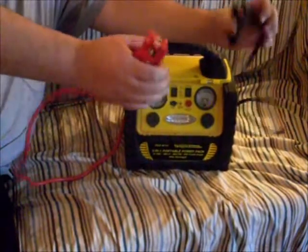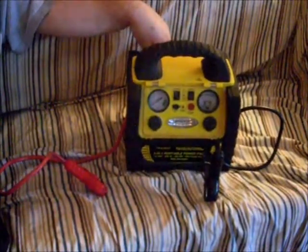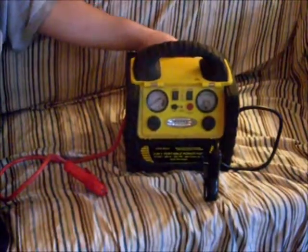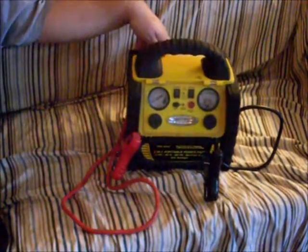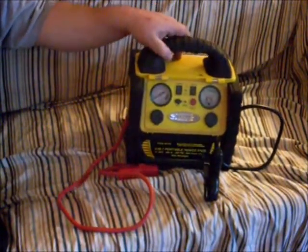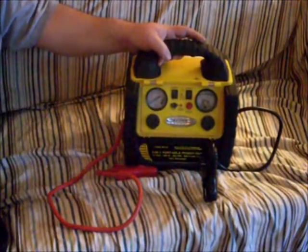What I like about this is you take these jumper cables, hook them to your car battery, and you can start your car or just start it every once in a while to charge the battery up. Flip the switch in the back to connect them, and they will be connected all the way through to your inverter, and you will be able to use this as a traditional 400-watt inverter. Also, if you start the car with these connected and the switch turned on, it will charge the battery inside here off of your car alternator. So if you're in a situation where your battery is a little run down, you can hook it on your car and charge it for ten or fifteen minutes, then go take it to another car and jump it.